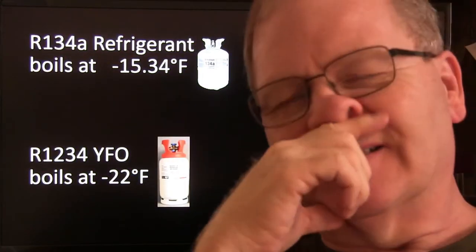All right, so you've got to know the new refrigerant. I'm not going to talk a lot about that this time. It's R1234yf, and it boils at minus 22 degrees Fahrenheit, which is when it turns from a liquid to a vapor. You've got your R134a that we're used to, that's in the light blue bottle, and it boils at minus 15 degrees Fahrenheit, more or less. And so it actually works a little bit better than R1234. There were some concerns about R1234 being flammable.